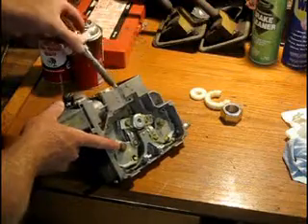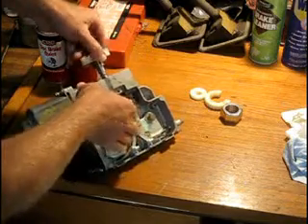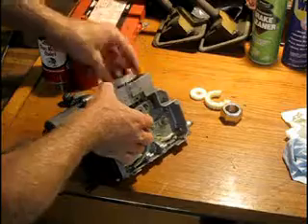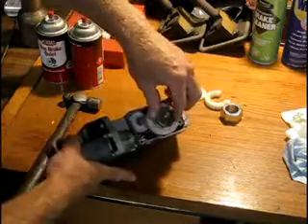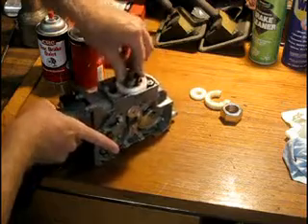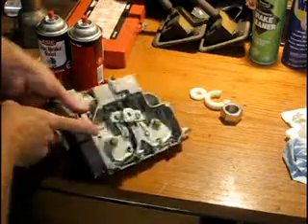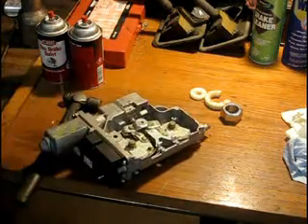After that, reinsert it into the assembly. Screw it back down in there as far as you can get it. Line up the teeth on the two top gears that it engages and it should drop right in. Don't forget to put that little metal flange back in with the T20 to lock the shaft from coming out.